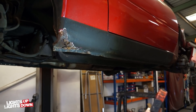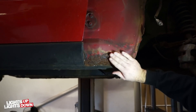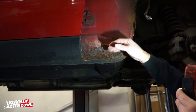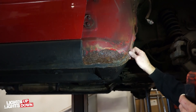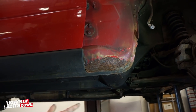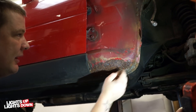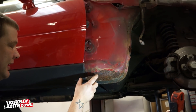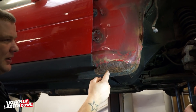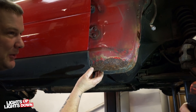It should support the jacking up of the car. Moving on to the front — this is really typical now. What we're seeing is once you get those front wings off, you've got this sort of problem to deal with. Often it will clean up — put some rust killer on it, a treatment coating and then a protective coating, and you'll be okay. This car, once we clean that up, will probably have pin holes in it. It's actually been worked on before — it's got a massive bulge that comes down here, and there's a slice already in there. Someone had done a bodge patch repair and they'd cut through the inner panel as well, then attempted to weld it up and put the patch over, welded the patch to the inner panel. It was a bit of a mess.